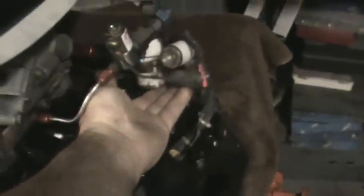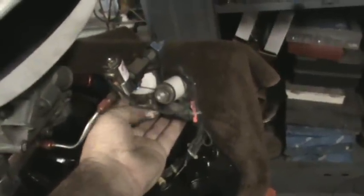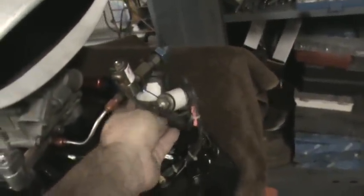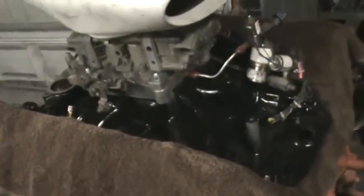Anyway, I got a few more things to get for the engine. And I think I'm going to go with this intake manifold. I got to make a bracket for this nitrous solenoid. And I got to figure out what to do with this fuel line here. I think it's going to have to go up like that. So when I built this, I incorporated it all in one location. Purge valve, nitrous, and the fuel solenoid. It's a little 75 shot on here, a little small hit, and it'll go up to 250, but we'll never use that on this because it's a cast piston motor. So 75 horse, can't get greedy with those 10 cans in there.